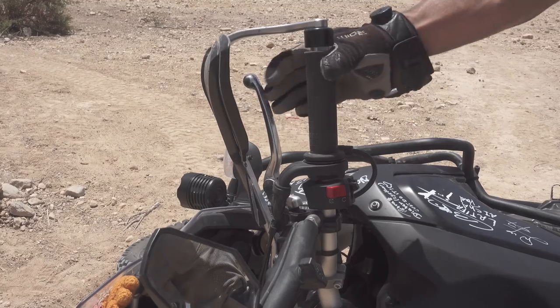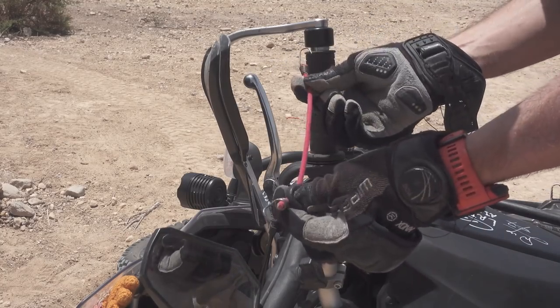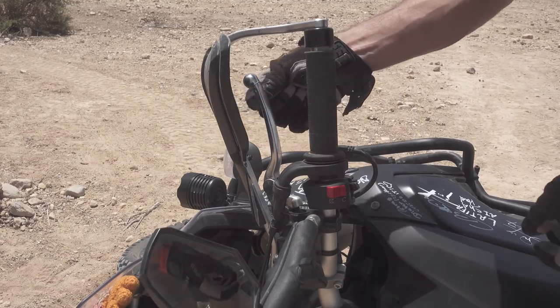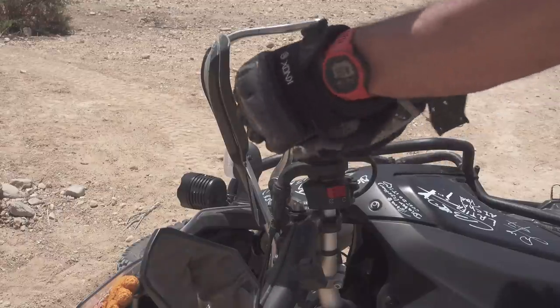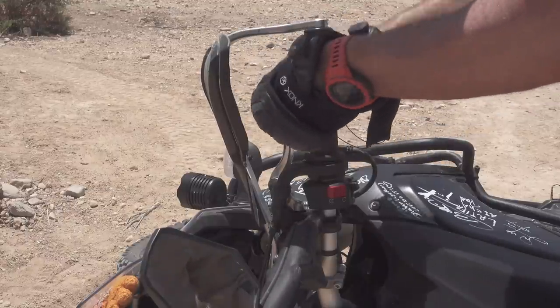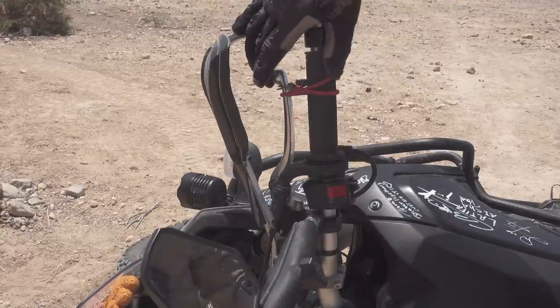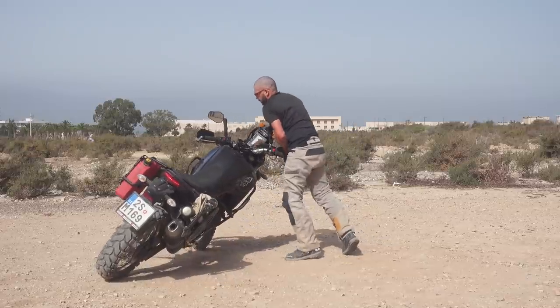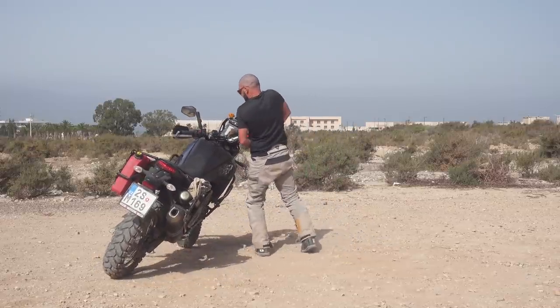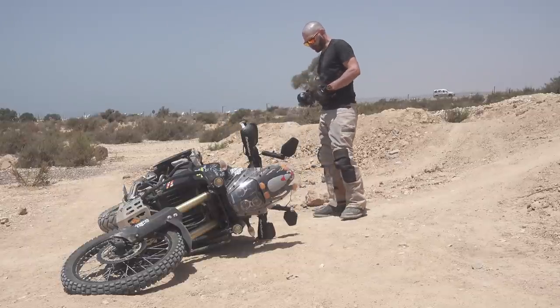What I need to make sure is that either the rear wheel is in gear, or I somehow fix the front wheel. I have a small bungee cord strapped on my front brake lever, which fixes the front wheel and engages the brake. The reason for doing that is that even on a slight downhill, the bike may tend to float around, and that may really throw you off during the lift.